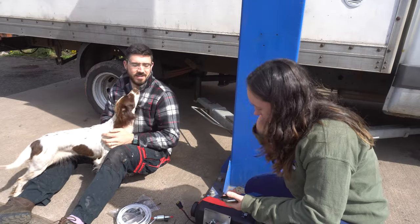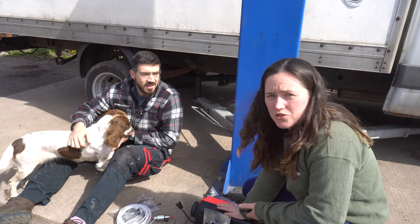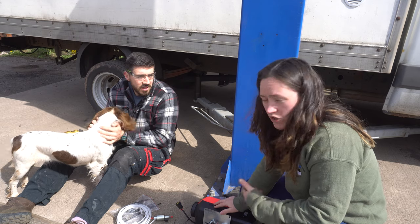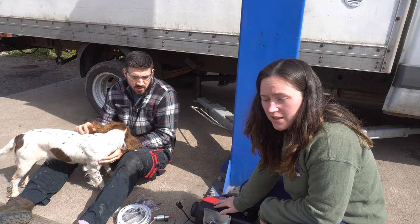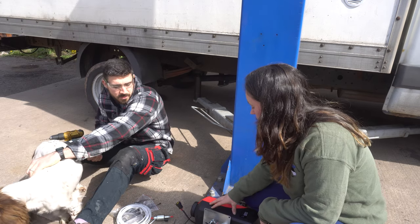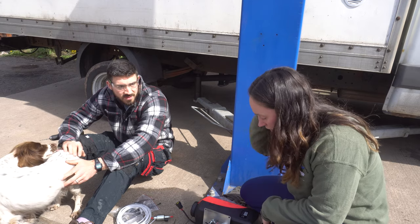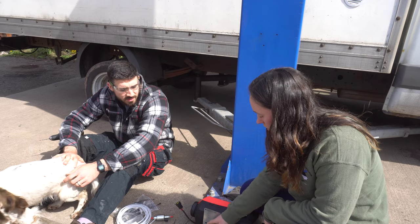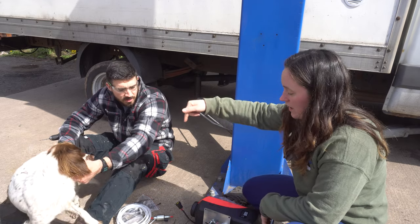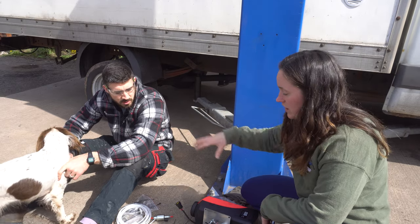This is the diesel heater we are getting started with. We're doing nothing unusual — we're undermounting it instead of having it in the van. After watching a ton of videos to figure out the best method for us, we're attaching this to the bottom of the vehicle using some bolts, keeping the base tray and having the exhaust and air inlet facing down. I'm just organizing everything in the right direction so that when we mount it to the vehicle, everything is in the right order.